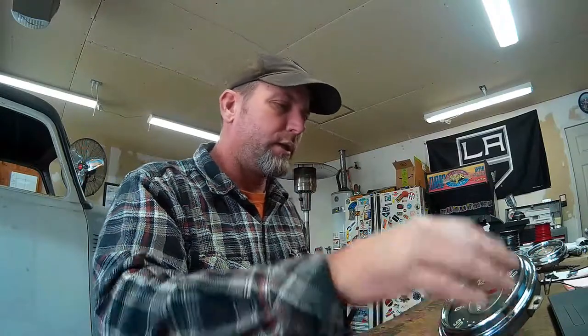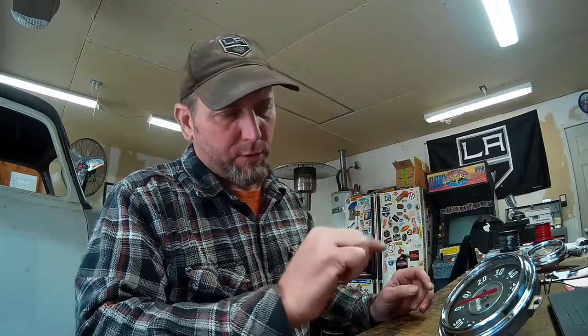So I'm going to wipe this down with some Windex. Get it nice and clean, the chrome as well. Windex is great for cleaning chrome. Give everything a good once over inside and out. Face the gauge, make sure I don't have any fingerprints on there. Make sure the chrome of the needle is clean. And then clean the glass, put it together, crimp the edges, and we'll be all set.